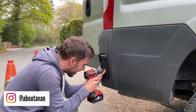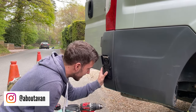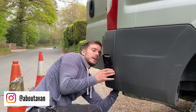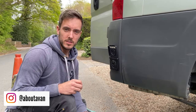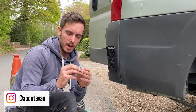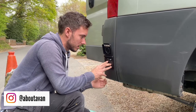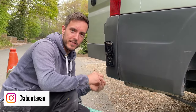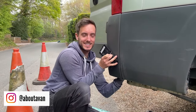I'm happy with that there. I'm going to try and get into the centre of that hole to go back. I'll make sure the plywood's on the back and I'm going to hold that plywood as I screw it in just so it doesn't move away and I'll make sure that the screw catches in. I've got a stainless steel screw and the Bullfinch kit comes with these little O-ring washers to go inside each hole — so that's going to go there, and then I'm going to go around to the back and make sure the wood is in place. You need five sets of hands to do this.